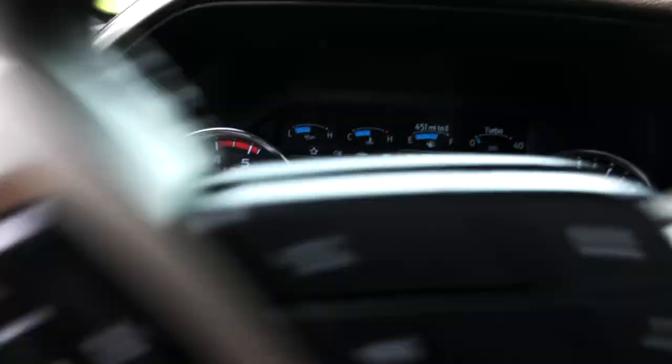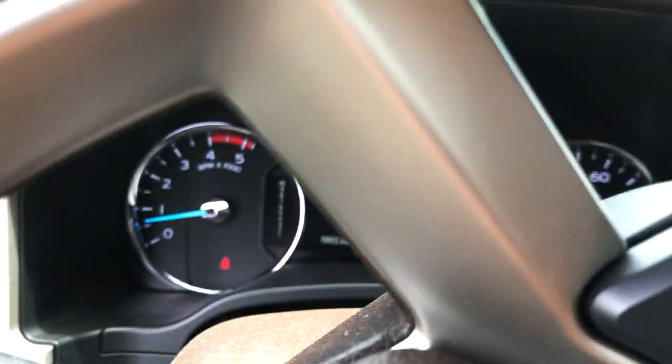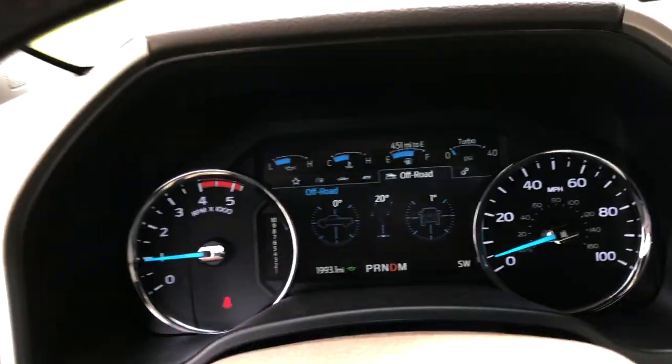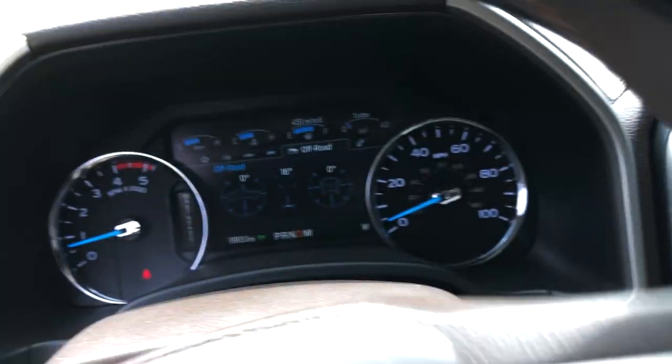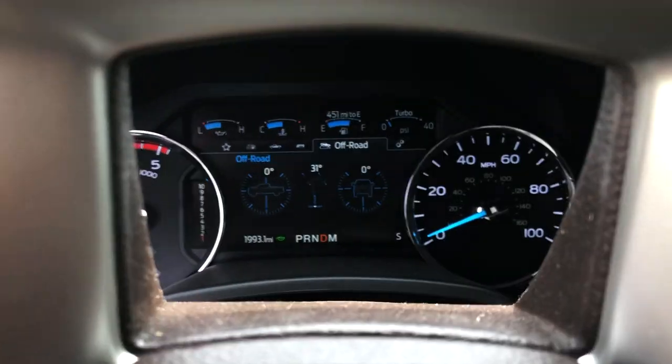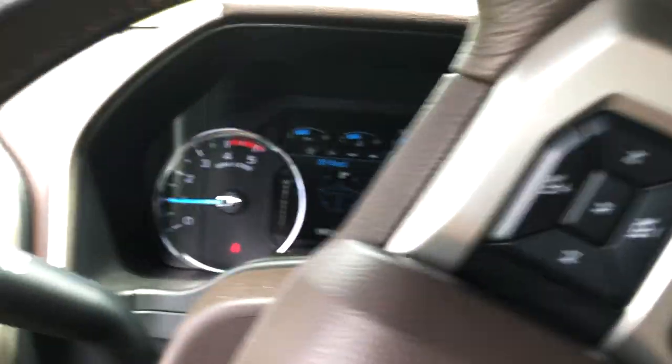Let me go the other way one more time. Turning to the right past 31 or 32 degrees it's going to start rubbing. To the left, when I get to about 33-34 degrees of turn, that's where I'll start to rub. Sorry guys, I don't have another cameraman to show you while I'm driving. In a future video I'll probably have somebody filming to show the tires while I'm turning. I'm really surprised and really happy with how it turned out — it looks great.